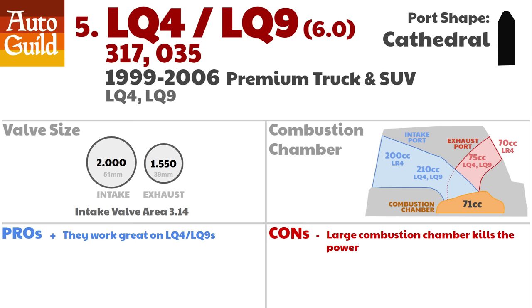When turboing that same engine, they lost 16 horsepower. Don't throw out those small valve heads — they perform. Some turbo guys insist on running these larger LQ-4/LQ-9 combustion chamber heads to get lower compression, but with computer-controlled engines, you don't really need to. Just use the head you already have for your turbo — the turbo is going to blast right past whatever valves you have.